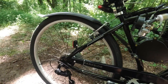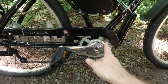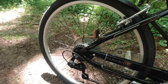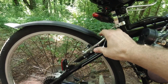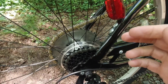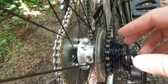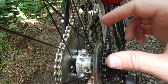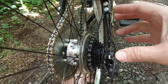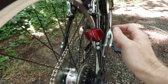The second problem with the beach cruiser is brakes. A beach cruiser only has one brake — a coaster brake in the hub when you reverse pedal — and that is just not going to stop you well at speed. I recommend going with double caliper brakes, one front and one back. Disc brakes are really cool, but there's just really not enough room once you see everything going on here, and fitting the disc and brake assembly would be too much trouble.